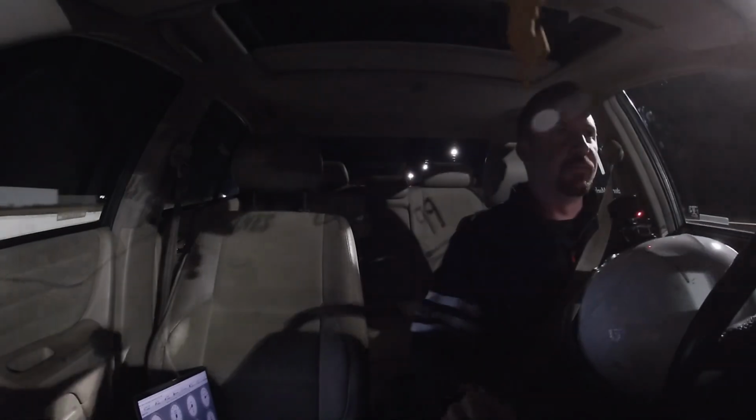Damn. That's not good. Boost cut like crazy. It's not good. I got the boost regulator turned all the way down and we still boost cut like crazy. Oh man. I did not expect that upgrading the intercooler and the pipes would mean that we just have to deal with more boost. Not ready for that. Well, let's take a look at the data log and see what we can do.